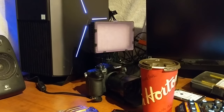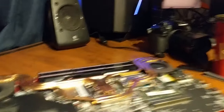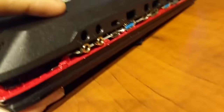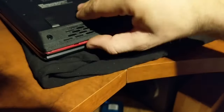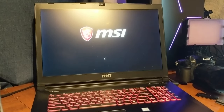Next thing is putting this bottom panel back on. I put it on straight — don't do what I did. Don't grab it by the heat sinks and bring it down, because right here it is hitting. You want to pull this up, put it down on an angle, and make sure you get those ports in there first. Snap everything in. Also when you're doing this, don't push on the screen — just push on the palm rest, because you could break the screen.